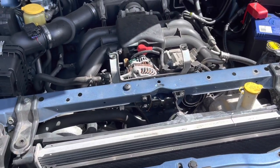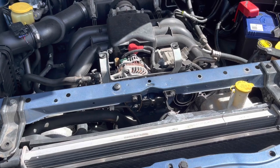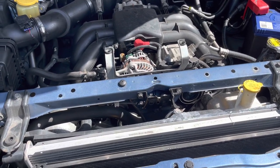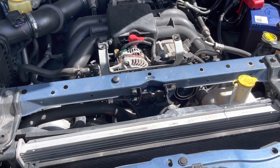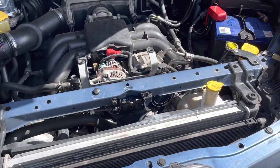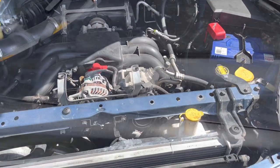So it's either the coolant is boiling somewhere, which it could be, because it's only got water in the system right now, and it's maybe getting a little bit hot, could be the radiator or something like that, or we do have a slightly blown head gasket.